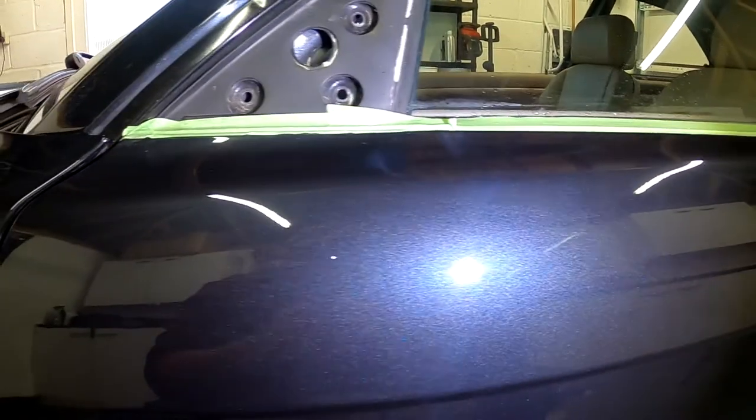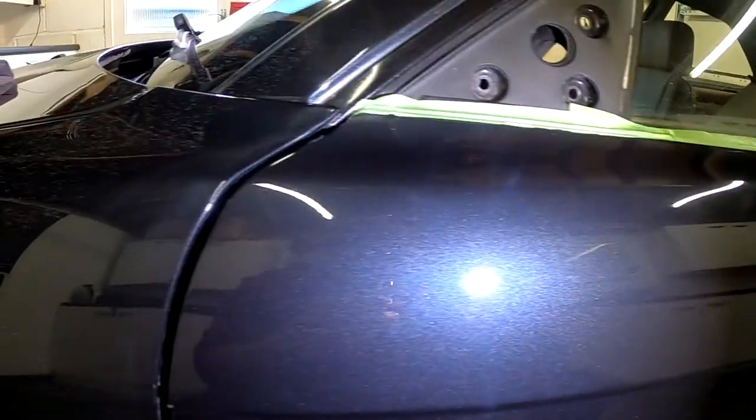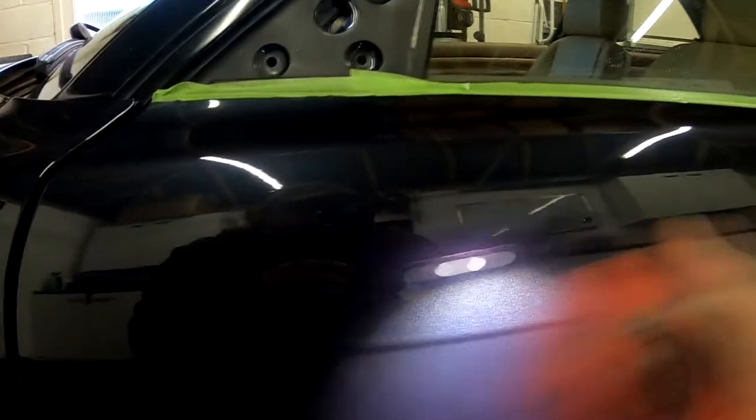We've really improved this paintwork. We go down here as well. On that main section, actually there's some scratches there, isn't there? But you get the idea. If we'd done our four sets, we'd have got a better improvement there. So this paint, you can make really, really good. And none of this is machine marring, it's all lines going this way.